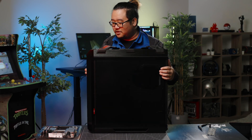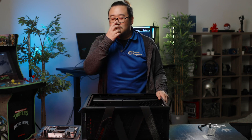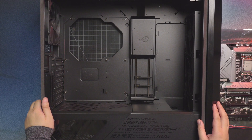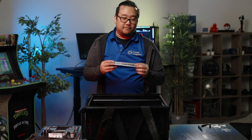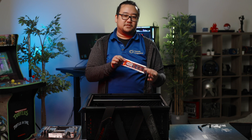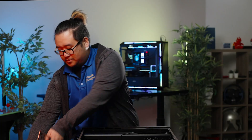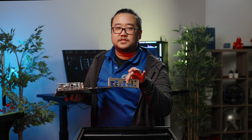The case we have here is the ROG Helios. It's a full-size tower, which means you can fit a lot of big parts like the RTX 4090 we have here today. The first thing you do is install this little IO shield here on the back of the case — not every motherboard comes with this now, but some still do. You want to line up the holes with the motherboard.